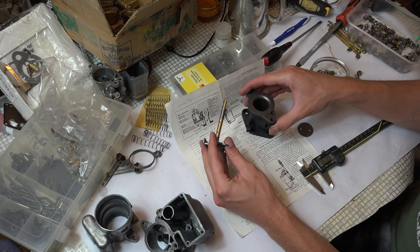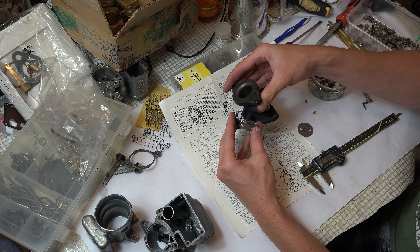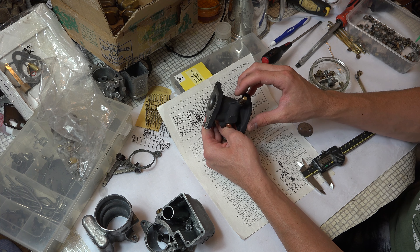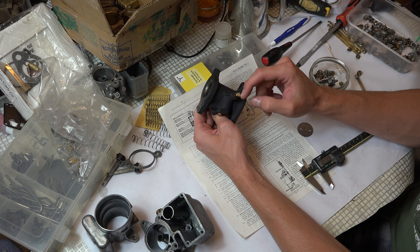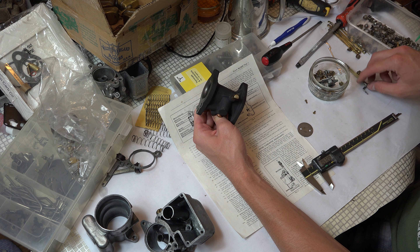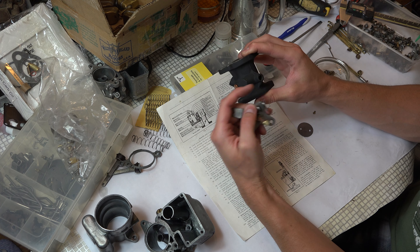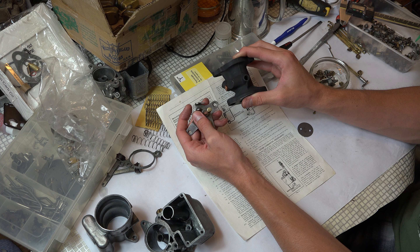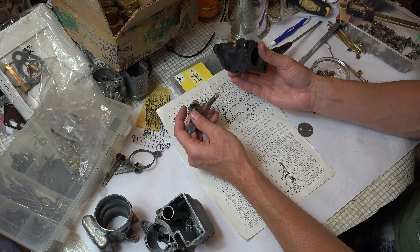This body isn't particularly worn either — put the shaft in and it doesn't rattle around. A really easy way to check is to put your mouth over the end, make a suction, and listen for leaks. It's a really simple thing to do. Right — I'll take the shaft out, suck it, and as the shaft goes in the sucking noise should stop as it fills the hole.